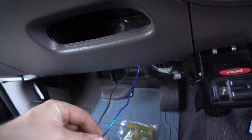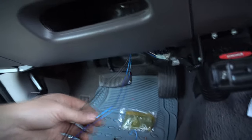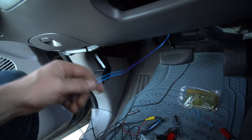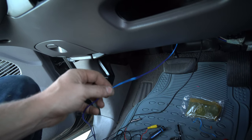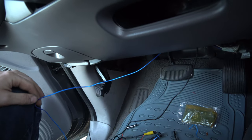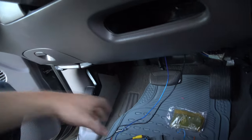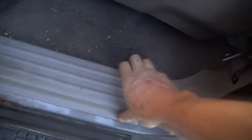This is for my reverse wire. I soldered this onto the purple and white wire, which is usually the color for reverse on the back of a deck. Then I have my RCA with the power wire down there. I'm going to try and find the reverse wire in the cab — if I can find it, great; if not, I'll run it to the back and connect it to the reverse light, which is the easiest way to do this without spending a lot of time, since you're already running this to the back of the truck for the backup camera anyway.